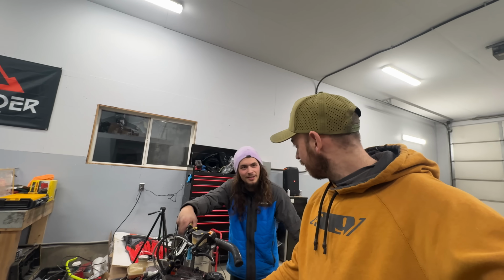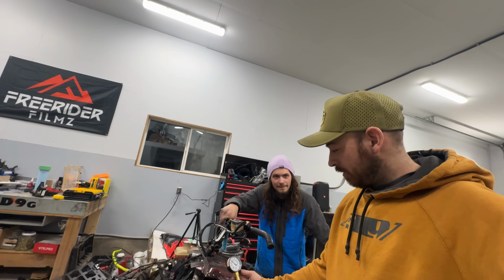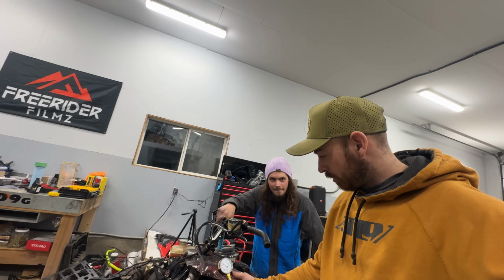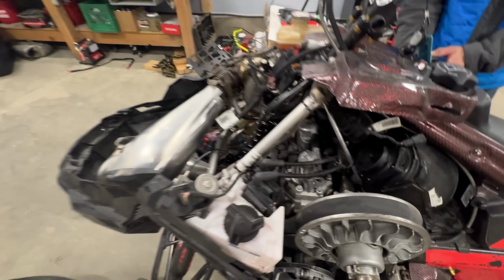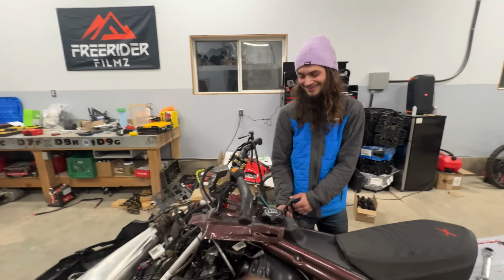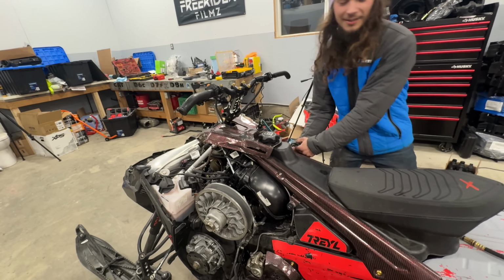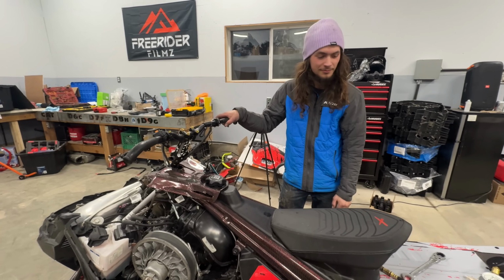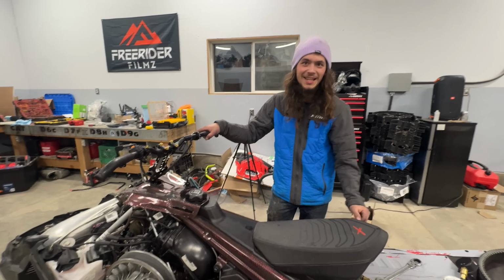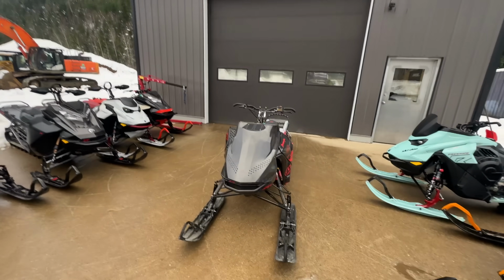I wonder if you just saw an electrical issue, like causing intermittent spark or something. Maybe try and check the spark again. Yeah. We'll check the other cylinder for compression too while we got it apart. But pour a little gas in the cylinder there, and let's see if it runs for a couple seconds here at least. It did. And here we are, revived.